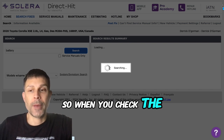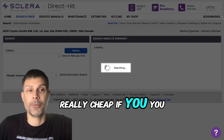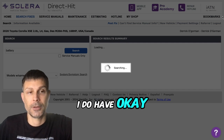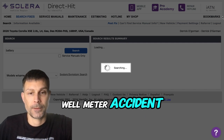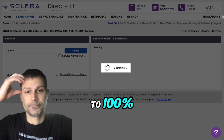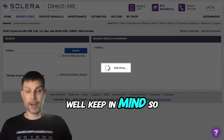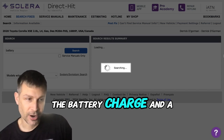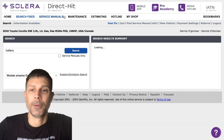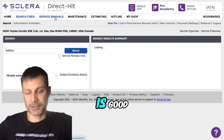When you check the battery voltage, if you have a voltmeter — I do have one, and I have my battery charger on and it charged up to 100 percent, so I figure the battery is good. Well, keep in mind, the battery charge and a battery getting load tested are two different things. Just because it's charged doesn't mean that the battery is good.